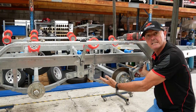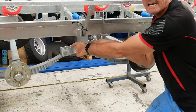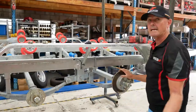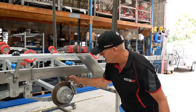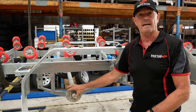This one has an eye-to-eye suspension with spring plates here. Again, it still has the same load rating, with the rocker arm in the centre. Load goes from front to back. This one here is a two-tonne rated trailer, so it's got a mechanical caliper and disc on the front and a lazy rear, rated up to a maximum of two tonnes.